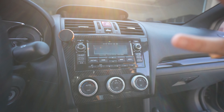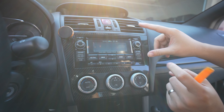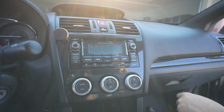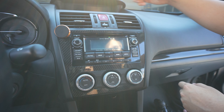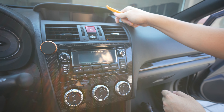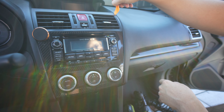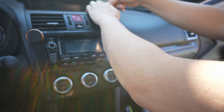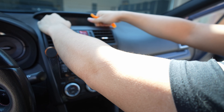All right, so we're in the Subaru WRX. We have the 2015 — really ugly old radio. To remove this bad boy it's actually pretty easy. There are these clips up top. Now these clips are actually super hard to take off, but you have to use a prying tool. Looks like this one's already been taken off though, so that's good. You just pull it.